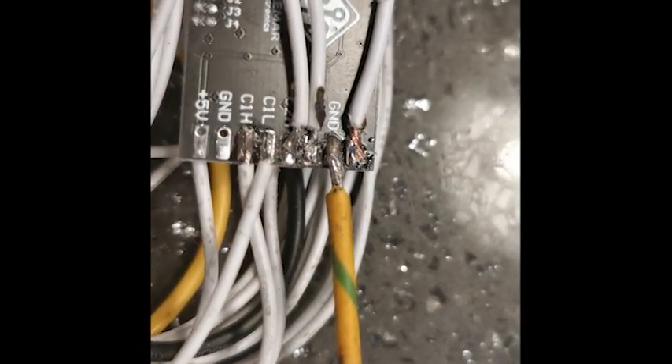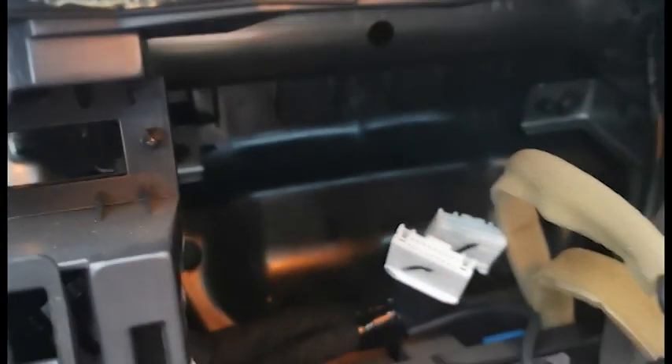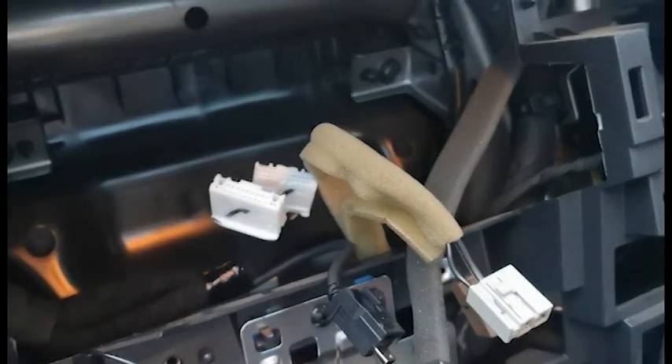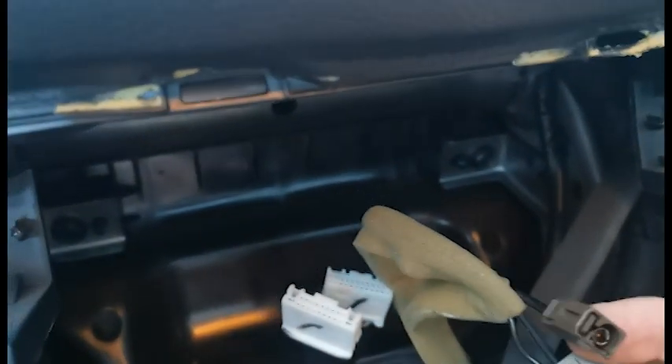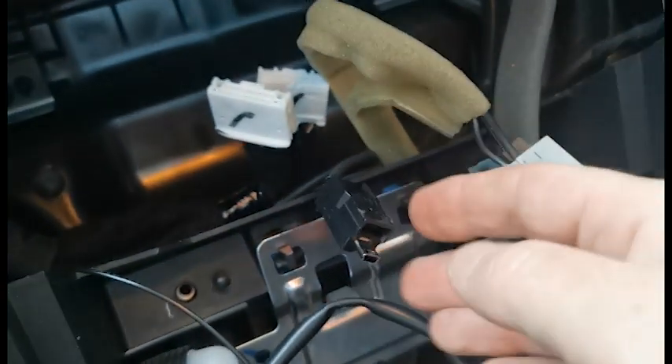Split the C2H and C1H — that goes to both of those. And the C1L and C2L. If my messy soldering can work, anyone's can. I know the video's not been the clearest at times — it's hard without some kind of stand. So these original plugs — this is the aerial plug, which I needed to get a new one of. They're available online but you have to buy like ten of them and the postage is a fortune. And one of them is for GPS — there's the blue and the brown, and then there's this one as well.